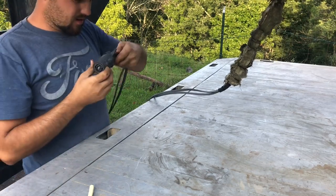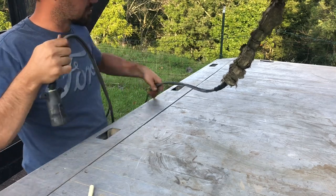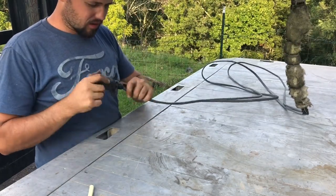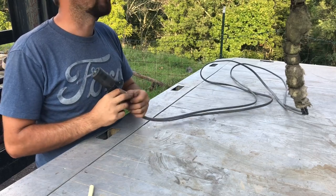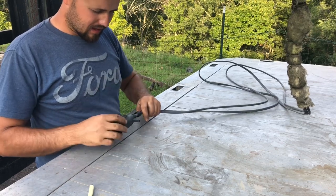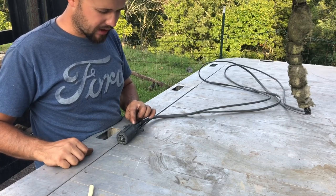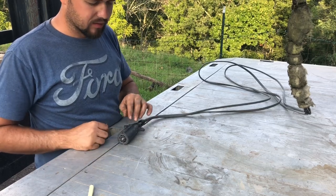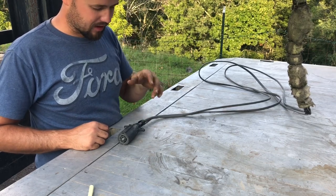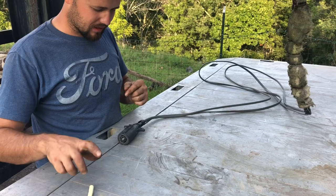There you guys, we gotta work on this here. Because I hit the brakes in it, that wrecked me. So, what I'm thinking in my mind's eye is it's either going to be the ground or the wire, the hot side wire for the brakes. I think it's going to be the ground just because I can wiggle it around and I get lights. So that's what I'm thinking.